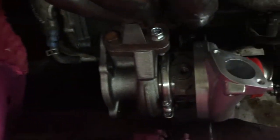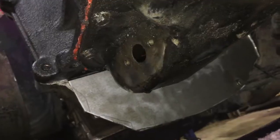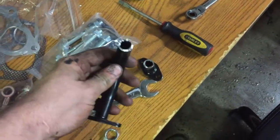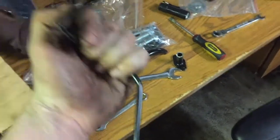More importantly is the oil drain that I need before I can actually put oil in the car. The oil drain needs to come from the bottom of the turbo. The line that came off the DSM and the new line that came with the turbo are the exact same, but because the turbo is flipped 180 degrees on the exhaust manifold it doesn't want to go right there — it wants to go way over here. So I've taken the new line and chopped both ends off. I'm going to get some oil line that will fit on this and make a flexible oil return line to the block. For the coolant it just comes with banjo bolts, so you can run coolant lines however you need. The oil feed appears to be the same thing, so that shouldn't be too difficult.